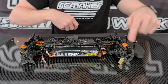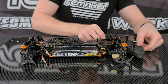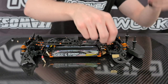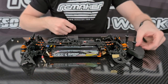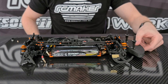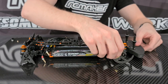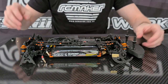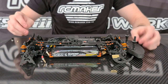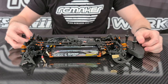Now we've got them both moving at the same time. You just pick it up so that the weight's about vertical again — it slides quite easily under your setup board so you don't need to lift the car up, just slide it straight back to horizontal. Let's try that again just to confirm. See this one's a touch early still. This is so accurate — it's ridiculously accurate, way more accurate than any other system because you can see which one's coming off even by just 0.1 of a millimeter.